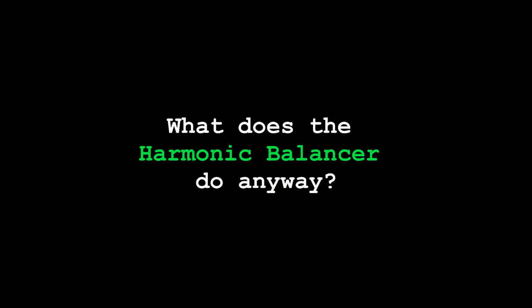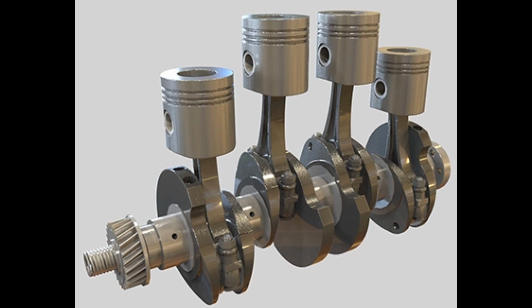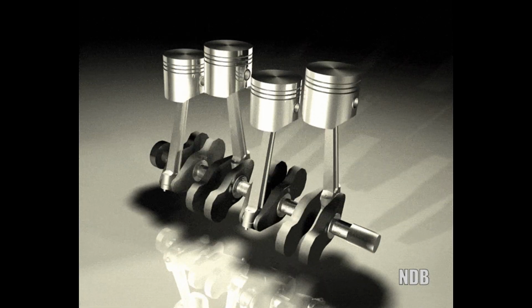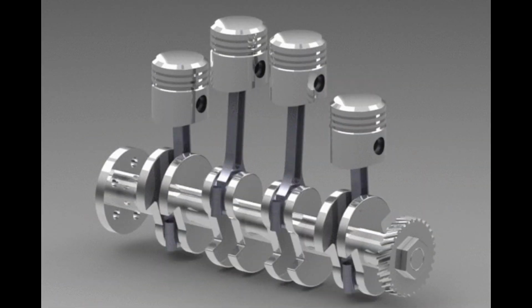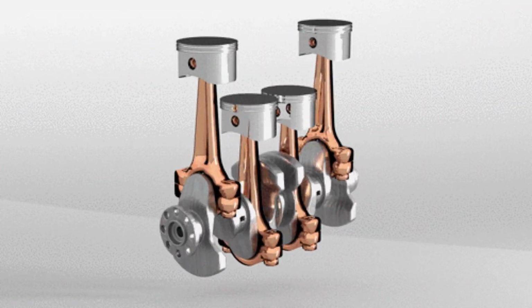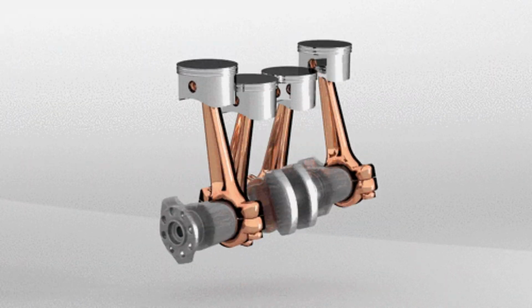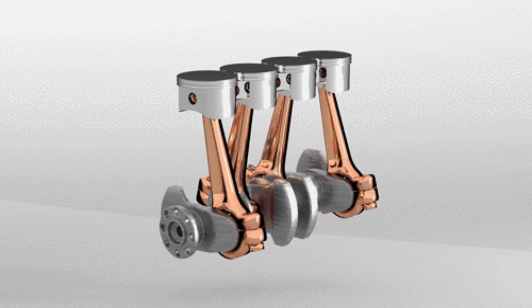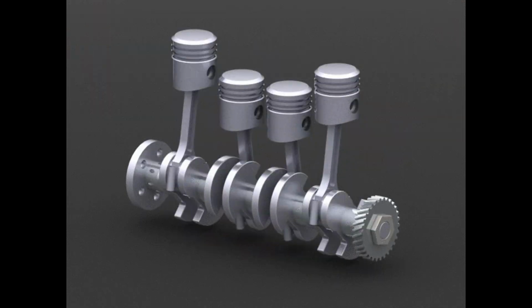A harmonic balancer, which is sometimes called a crankshaft dampener, is the same thing, except that the balancer includes a counterweight to externally balance the rotating assembly. Each time the cylinder fires, the force of the combustion is pressed to the crankshaft rod journal. The rod journal deflects the torsional motion to some degree under this force, but harmonic vibrations will result from the torsional motion pressure on the crankshaft. In some engines, the torsional motion of the crankshaft at certain speeds can synchronize with harmonic vibrations, causing resonance, like a guitar.